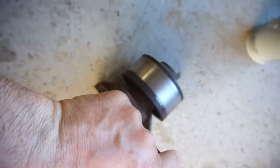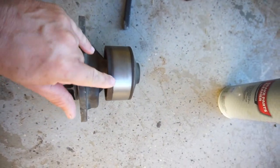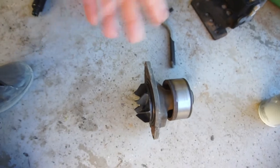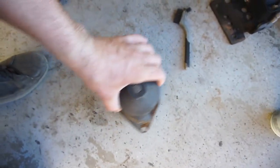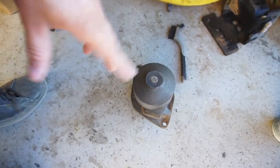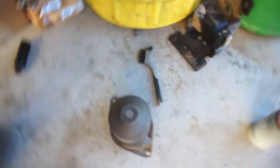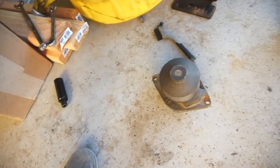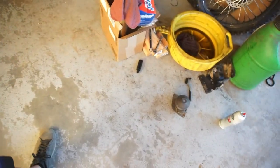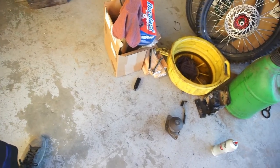From there all the way to there — right there. There's a recall on these if you have — I believe it's 2013 and newer. The guy took this to Dodge and they put a new water pump on it. The water pump took me about five minutes to install, and the serpentine belt took about a half hour because you've got to take the tensioner off.